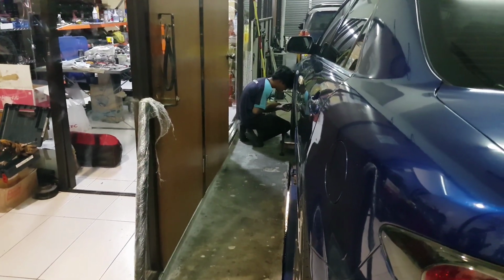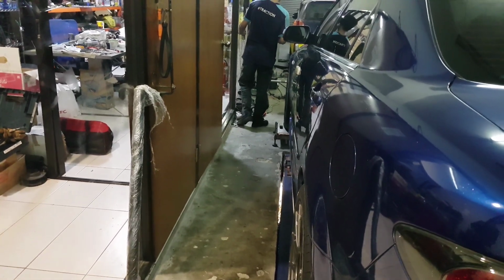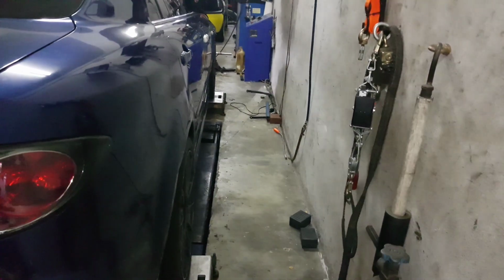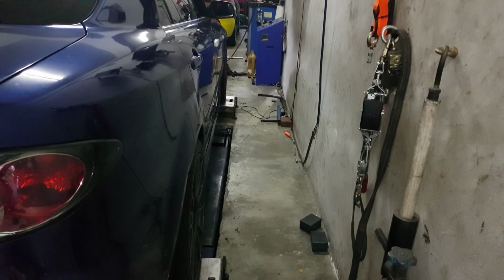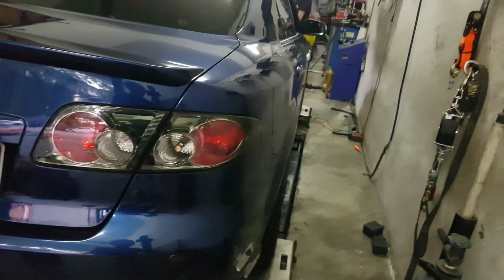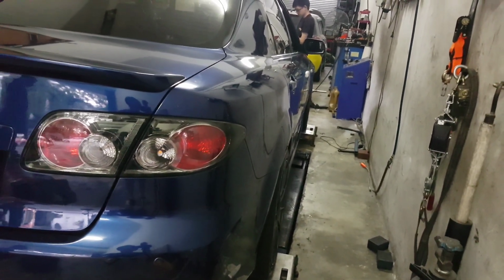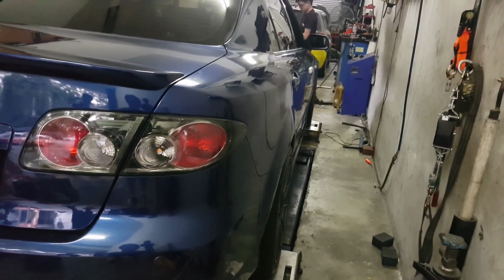Okay, so I might as well show you guys the front being measured. The right side earlier was actually showing a toe out, and how many mm difference just now at the front? 1.5 mm. How many degrees does it translate to? Less than a degree, probably 2 to 3 minutes. Okay, so a 1.5 mm difference will translate into 2 minutes of a degree, which is still less than a degree of toe. There are certain calculations to be followed in cases like this.